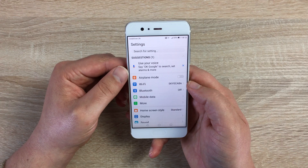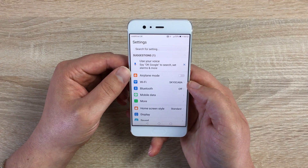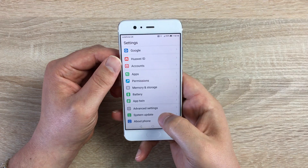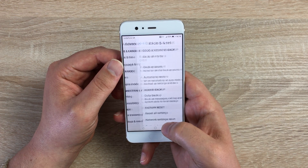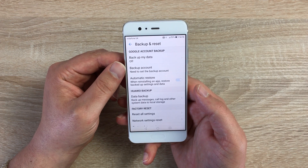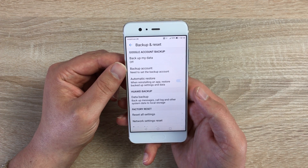The last thing I want to cover: if you have any software issues you can't fix, make sure you back up your SD card and remove it first. Go to Settings, then Advanced Settings, and scroll to Backup and Reset. You can back up your data and then reset to factory settings — returning the phone to how it was from the store with no personal information. All photos, videos, and applications will be removed, so please take that SD card out before doing so.